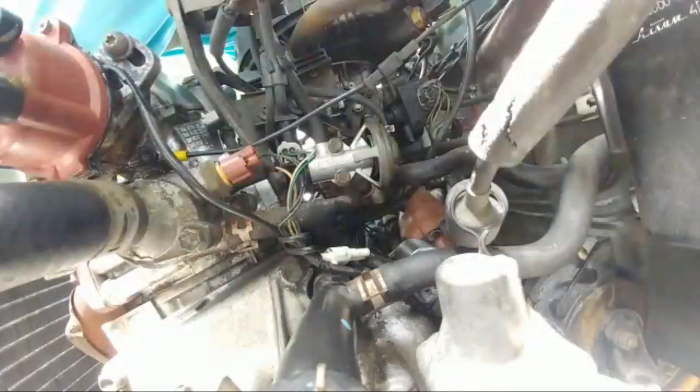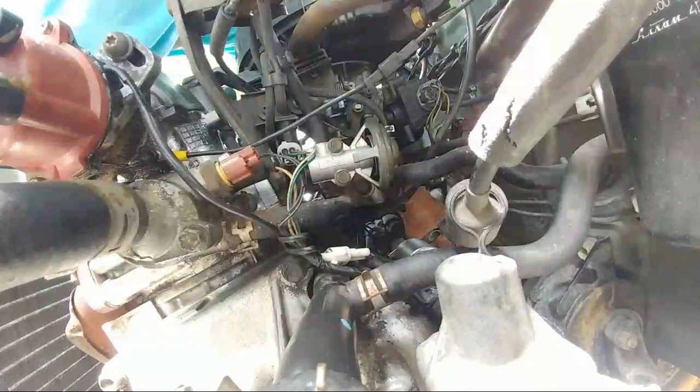Now this is a copper stud. It's not made of steel, so we cannot be tightening it as tight as if it was a steel bolt. It's just got to be snug. It's just got to be to the point where it'll sandwich that wire and make good electrical contact. Just stop. Now it's resisting, so we're going to snug her up. There, snug.